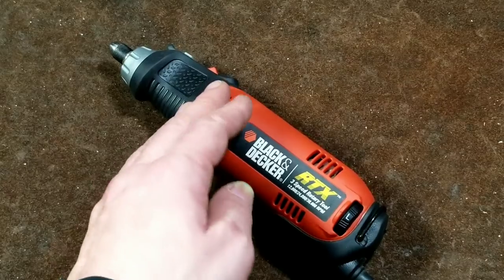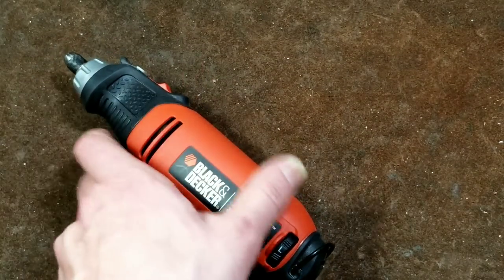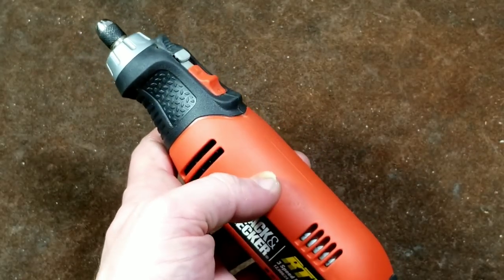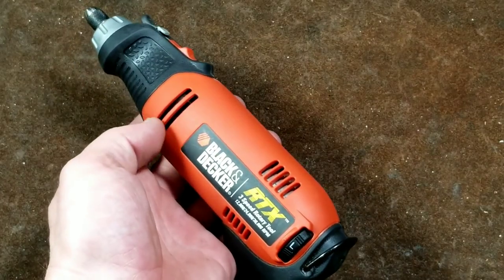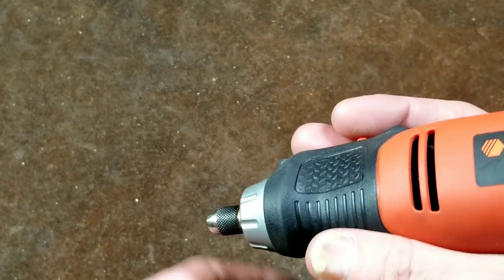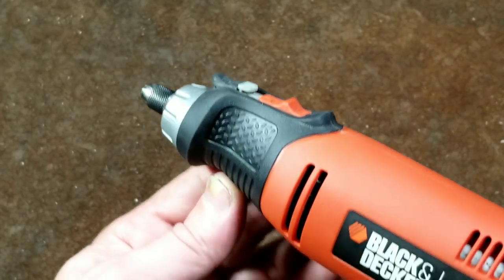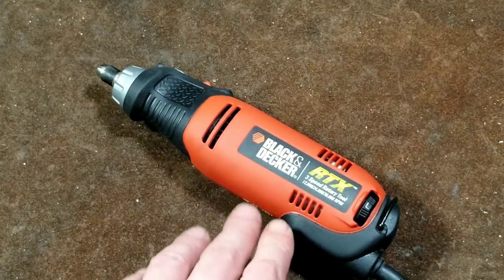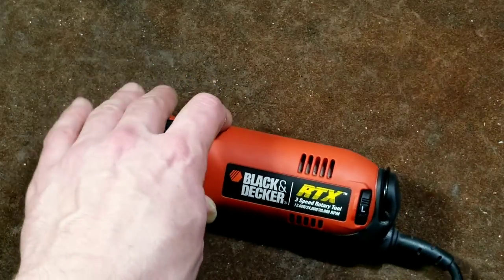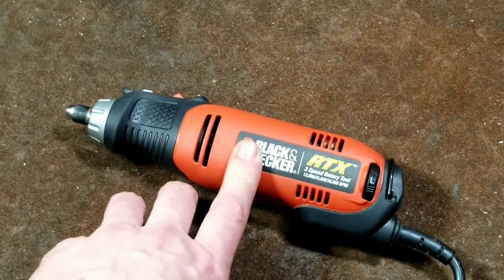What prompted me to do this video was a couple of comments. One was about a common issue with many rotary tools: there's a button to lock the spindle so you can tighten and loosen the chuck, but that ends up being the Achilles heel of many Dremel brand products, knockoffs, and rebranded ones like Craftsman — which are just Dremel tools with a different label. As you're using it, you bump that spindle lock button while it's running, and it can snap the spindle or at minimum break the little locking pin inside. Another user commented that on their cordless lithium-ion Dremel, the button was accidentally pressed when they turned it on and it blew out the electronic speed controller.